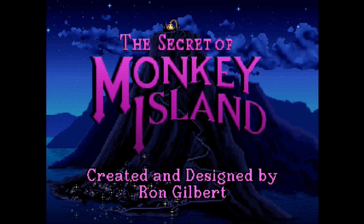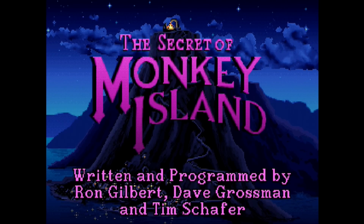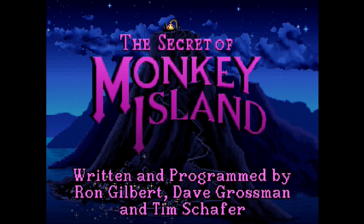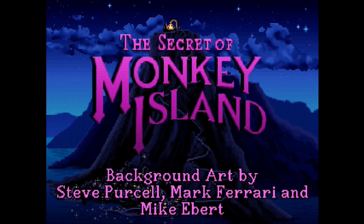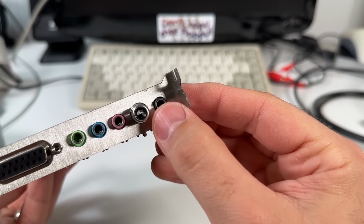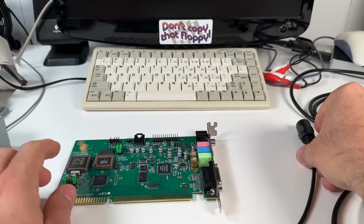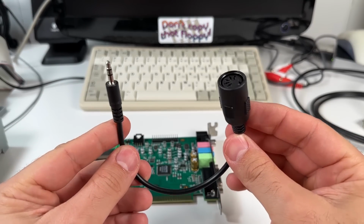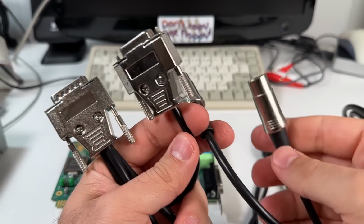Having intelligent mode support is a really nice feature for people planning to run an MT32 on older systems. But PC MIDI is also a very solid bug-free implementation, so you don't need to worry about hanging notes or any other weird problems. It also has a dedicated MIDI out port with a 3.5mm to MIDI connection adapter included with the card. This is really nice because you don't need to use the game port and those clunky adapters like you would with typical sound cards.